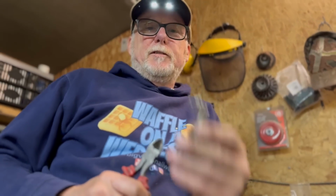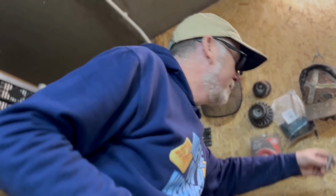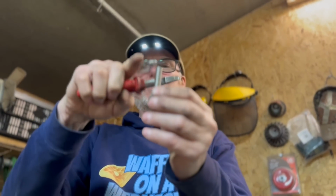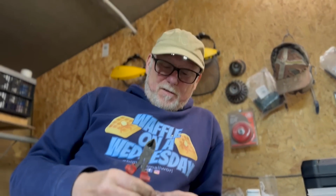I think we're going to pause this again. So the spring is too long. Hang on, let me get you one. First off, Mel needs a spring. These are the springs I've got, but they're slightly too long to stop the door from jamming. So what I've done, I've bent one over, and I'm going to recreate a coil end here, making the spring that much shorter. By my calculations, it should be about right.